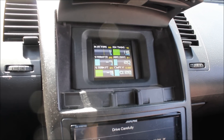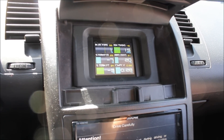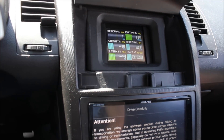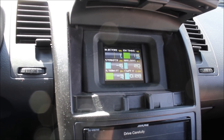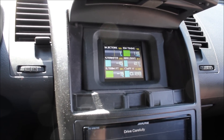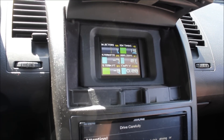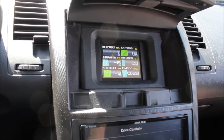It seems that when these vehicles learn their parameters, they kind of stick to them. For example, Trevor's car — when we did the MREV, we're getting a lot more air into that intake plenum and the computer got unhappy. After an ECU reset and learning all the new parameters, it was happy. Same thing with my car: with the test pipes on, it needed the ECU reset to learn its new parameters, and now it seems to be happy again.